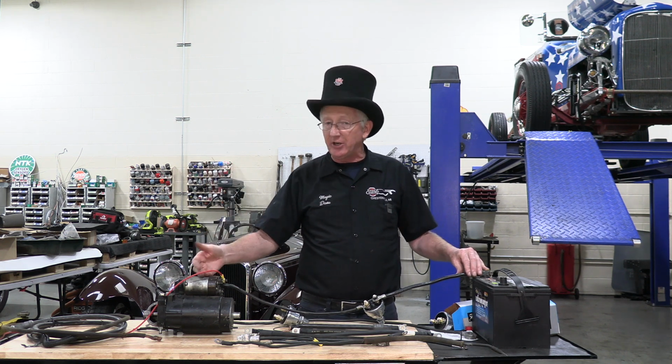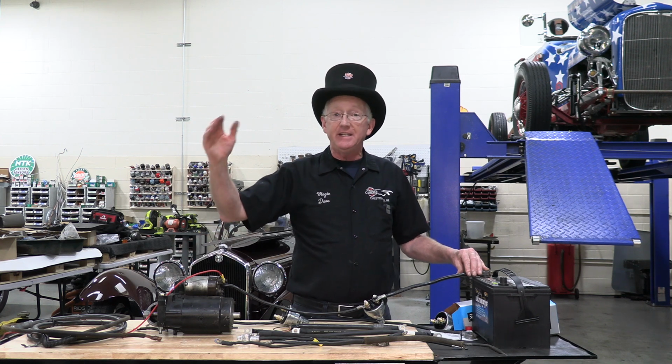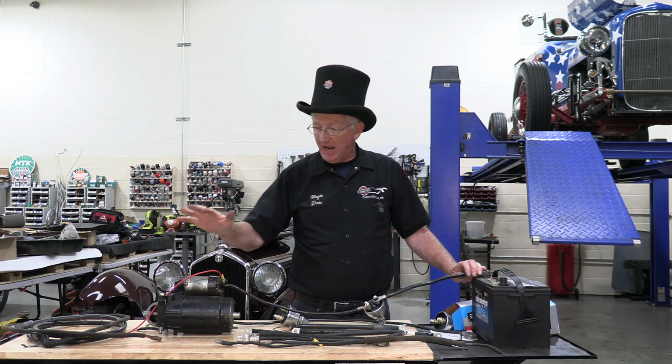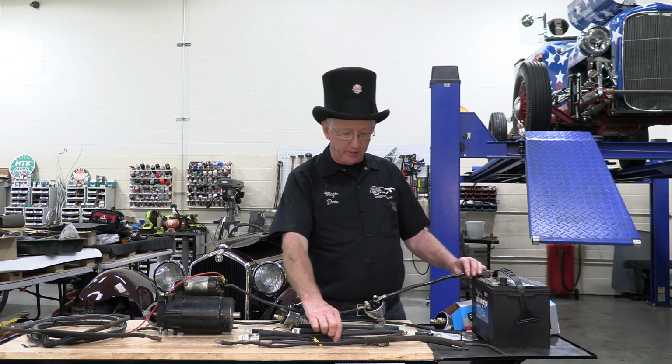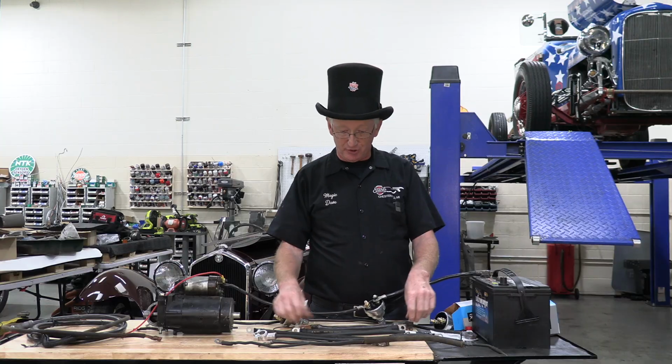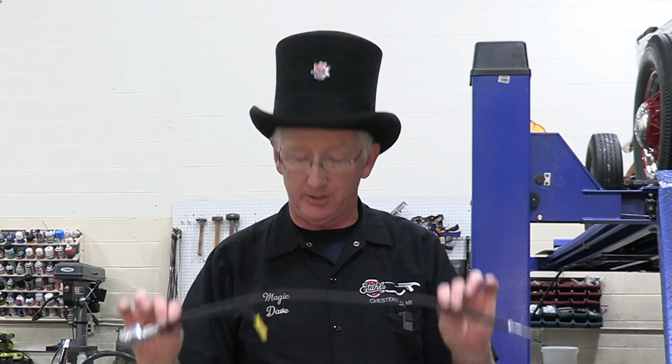And if the voltage goes down going into the coil, the voltage available to fire the spark plugs goes down. So if the engine's turning slower because lack of current, and the ignition coil voltage to spark the spark plug drops, then you have two things keeping your car from wanting to start easily: low voltage from the ignition coil to the spark plugs, and a slow turning starter, all because you put in these teeny little cables where these big cables belong. If you have any questions on an old 6-volt system about cable size, you can't go wrong with a bigger cable. You certainly can go wrong with a smaller cable.